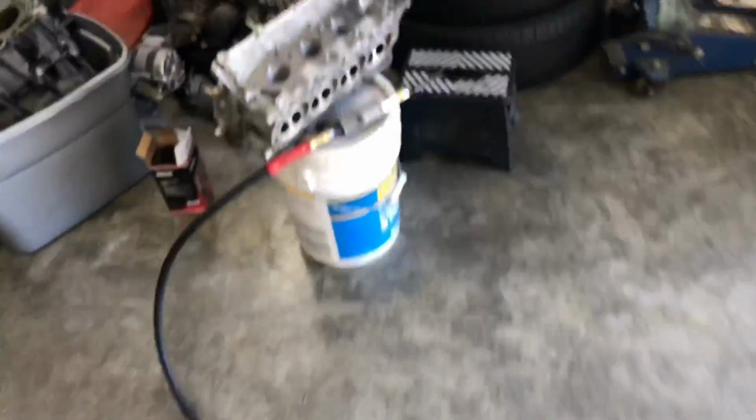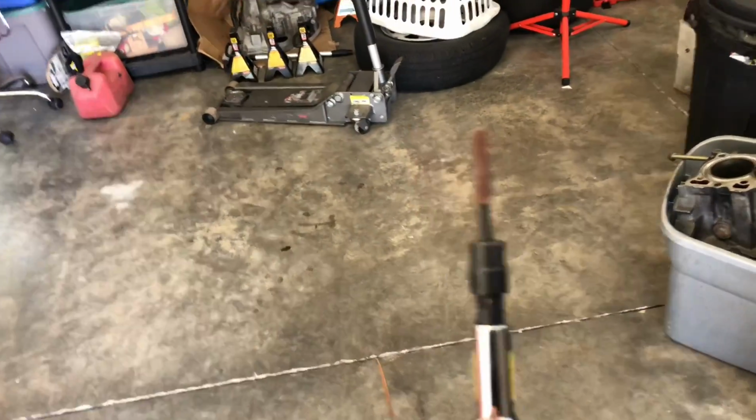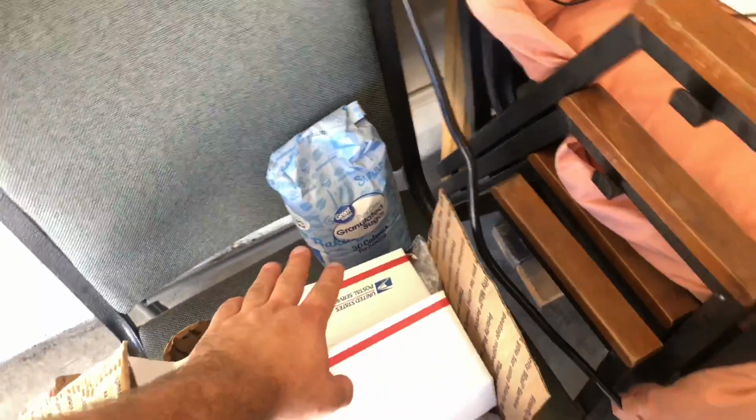And for that, we are going to be using this die grinder with an attachment for a sandpaper bit. We're just going to clean that up very well. After we do that, we're going to fill the jackets with sugar, granulated sugar. Doesn't have to be anything special, but the key of using sugar is because this is easily dissolvable by water, and we're going to set the Devcon over top of it.